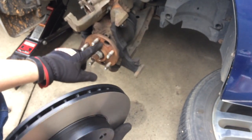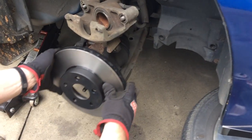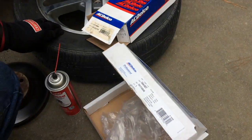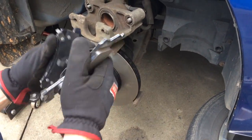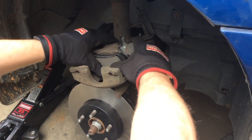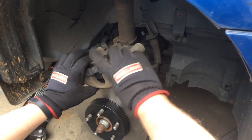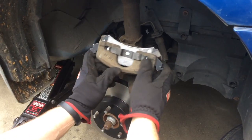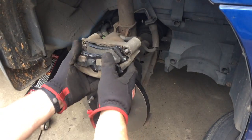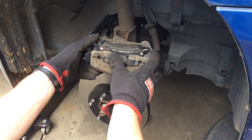I've also taken a wire brush and cleaned up some of the corrosion buildup on the hub, just so it's a little more cleaned up. I'm going to put the rotor back on the hub — it's that simple. Then we're going to install the new pads. The inner one just snaps into the caliper's cylinder, and the outer one is held on by these clamps. Inside there are a couple of notches built into the pad — make sure you can see them clearly in the inspection holes.